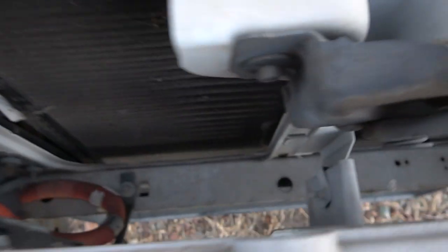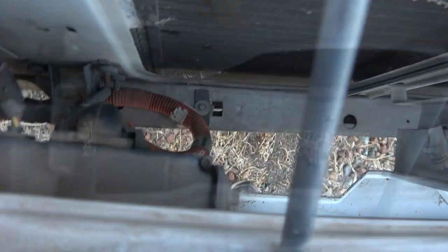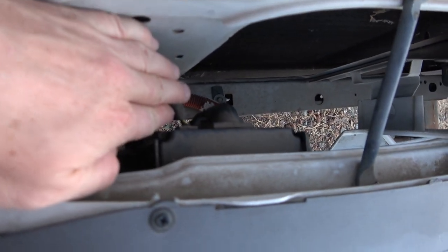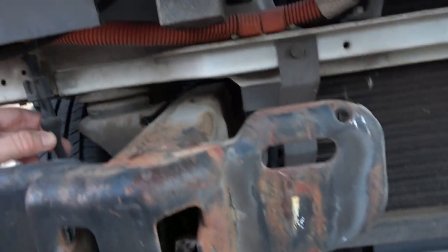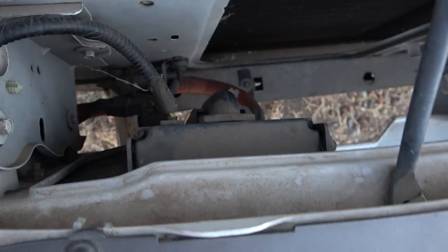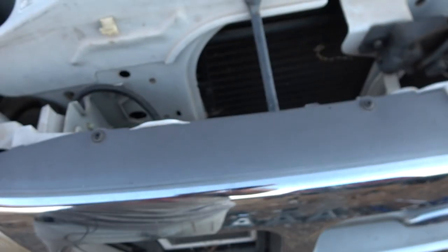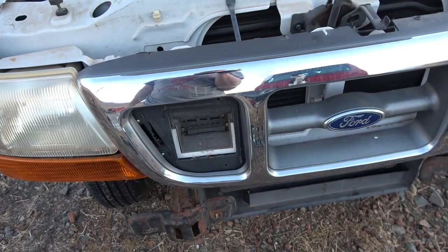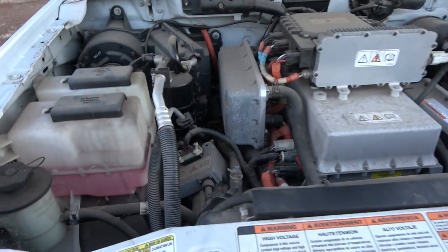But the other thing is, so that's the main power wires going into the charger. But there's also the communication, proximity lines, all of that for this. And so, yeah, it has these pilot wires here, pilot communication, and maybe I can't see them here, but yeah, there's just a little plug to plug them in. So I'm going to be unplugging that because I'm going to need those as well, converting this to that same, oh, actually, here it is, right there, you can see straight down, but converting this over to that J1772 standard so I don't have to worry about finding an AVCON charger or using an adapter. It'll just have native charging for the modern era.